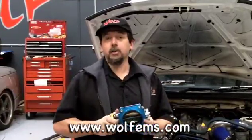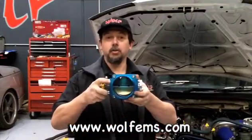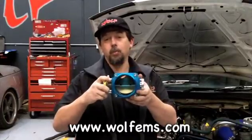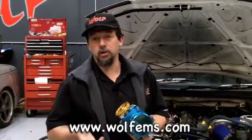People love these 90mm throttle bodies because they will flow a lot of air, but if you're putting this on a 1300cc engine, anything more than about that is useless. You open it up and it's not going to give you any more power — you've already reached what the engine's capacity will allow at about a quarter open. If anything, it's going to send you backwards, because on a sharp acceleration like that you get a big rush of air very quickly and you have to accommodate that with fuel and ignition timing.